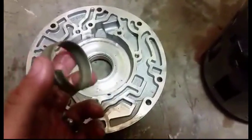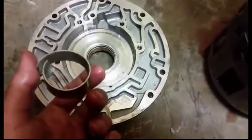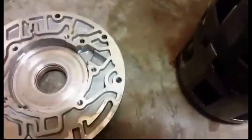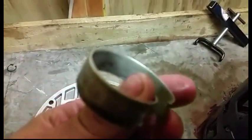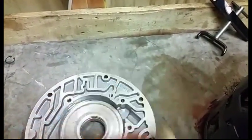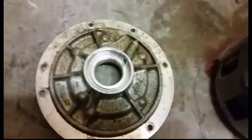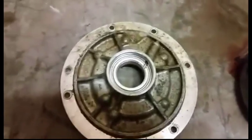A lot of people don't even replace them. I do, especially if there's noticeable wear. I have left them in before if they look exceptional, but this one obviously did not — it's awful looking. All that pitting. That's a very critical bushing, along with your rear bushing that supports your output shaft of course.